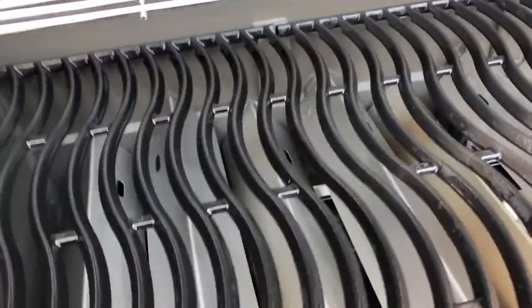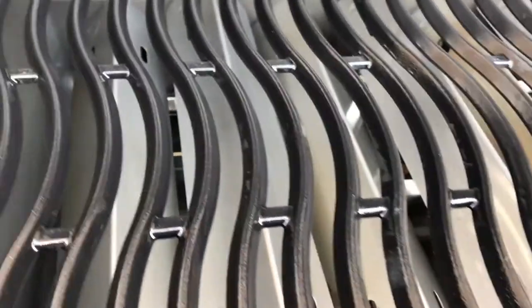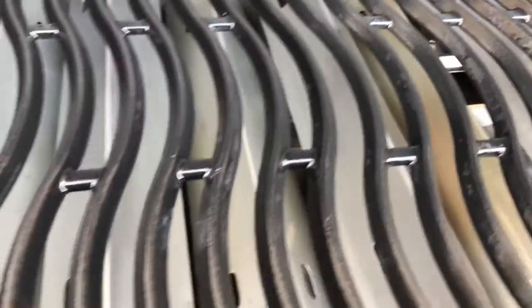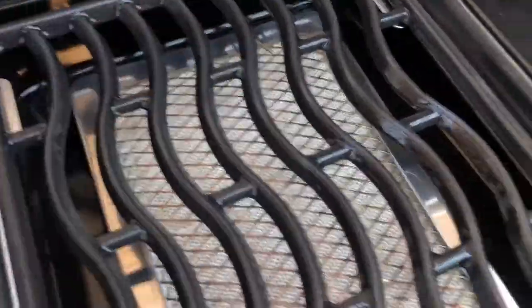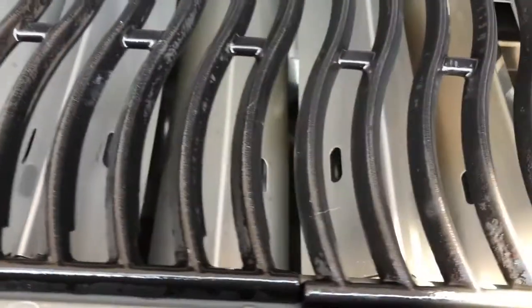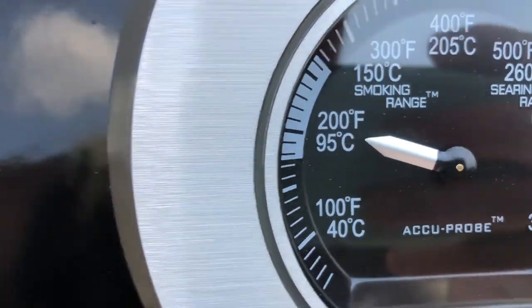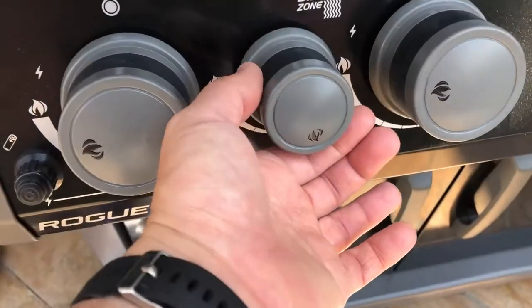I put everything back and I'm going to turn on the main gas — now it's going into the barbecue. The way this works is you turn the knob and you hear a click because you essentially snap some kind of piezoelectric sparker, and that gets the flame going. During the day it's kind of hard to tell there's actually a flame; I have to listen for a sound or feel it with my hand. I'm going through each burner now. We're up to about 200°F and I'm going to be up around the 350–400°F range.